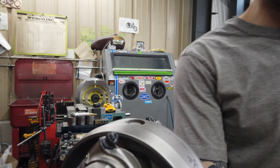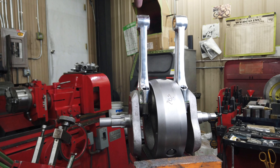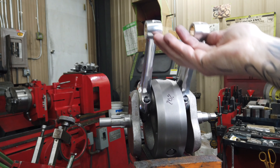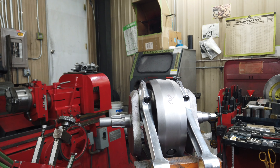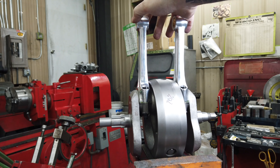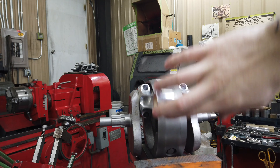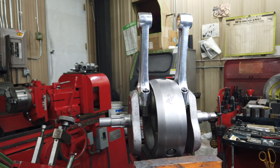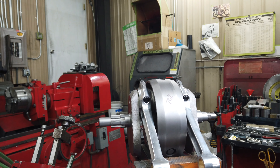This is my favorite part - the old rod drop. Oh, so close to being the same. It doesn't really prove much other than it's not completely loose and my assembly lube is really sticky, but it looks cool. If you were going to assemble this and run it right away you'd probably want to use something a little thinner, but because I know a lot of the stuff I send out is probably going to sit for a bit, I like to run something a little heavier so it hangs around a little longer.